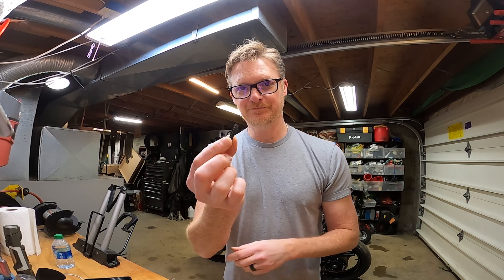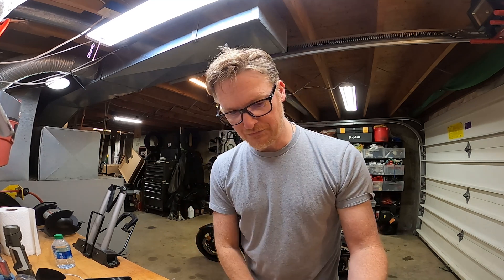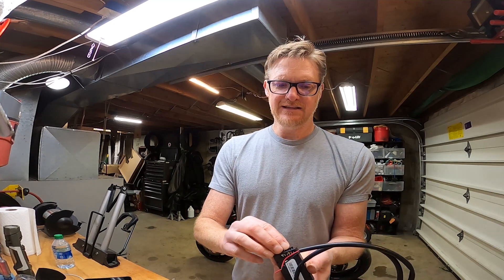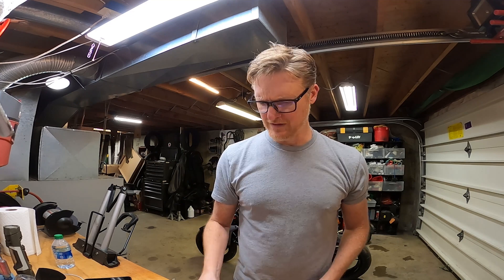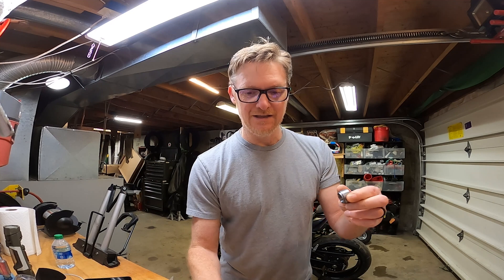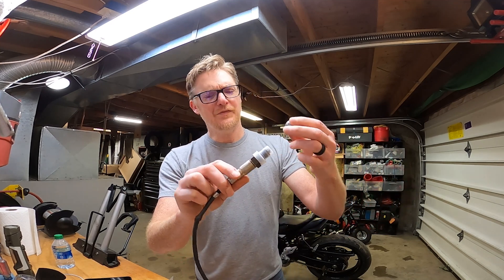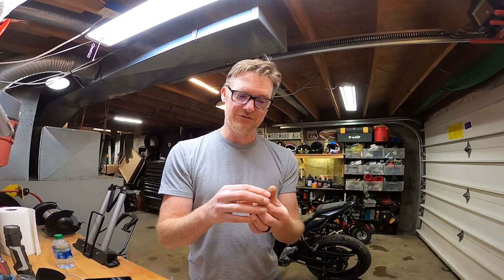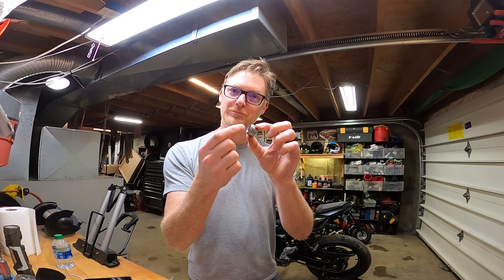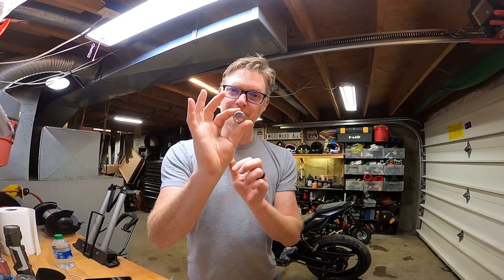Check this out — there's a little plug that seals up the holes, I'll figure it out when I get closer. And then there's this cool thing: this is actually the O2 sensor bung. If you have an aftermarket exhaust and you don't have a place to mount an O2 sensor, you drill a hole, weld this in place, and mount the O2 sensor.